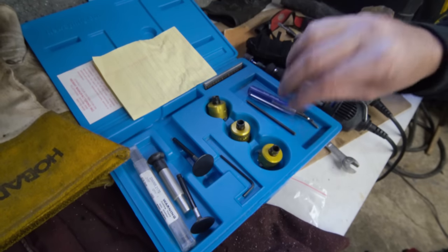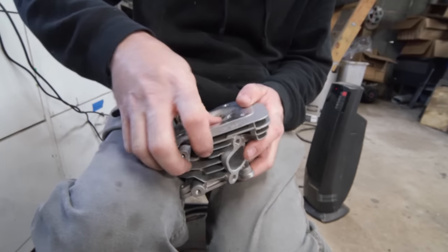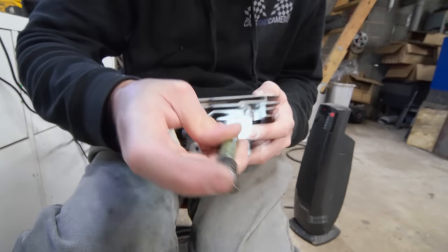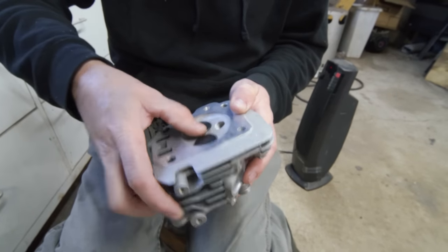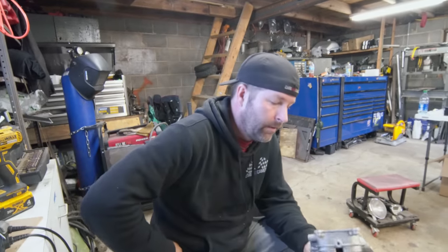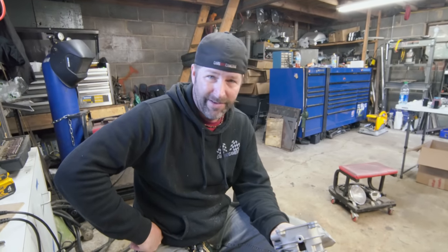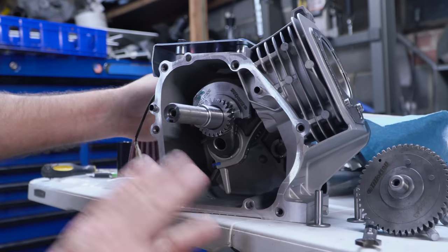We removed material from the seat. Let's check the valve — it looks dead-on. So there's the exhaust and here's the intake. The valves are in there, all we have to do now is install the springs. A lot of people would like to lap the valves, but we were told not to on this one, so we'll just look at it real good and decide.